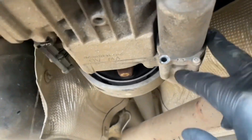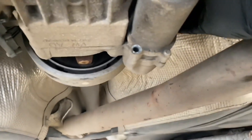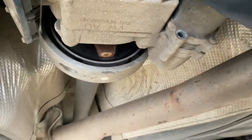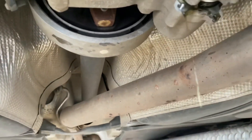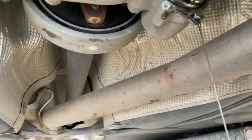The pump is only sitting in there on seals. We've removed the two bolts and there is wiring up above so you've got to be really careful. Be very, very careful when maneuvering this pump off. It's a bit of a tight one but it does let go - just like that. And as you can see, even more filthy oil comes out, which is good because that's what we're going to clean out.